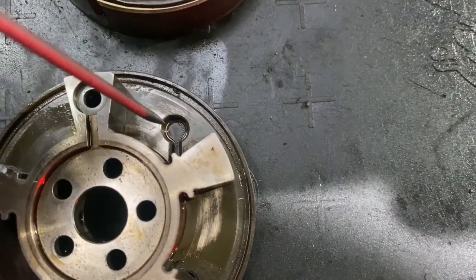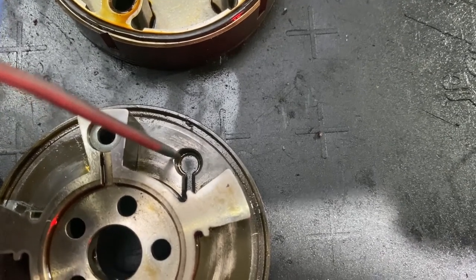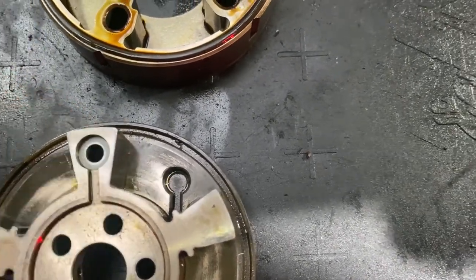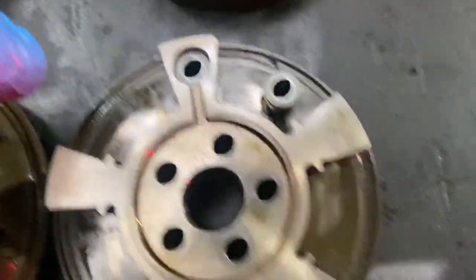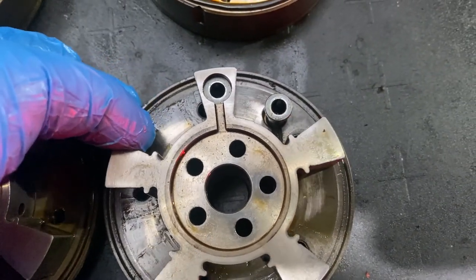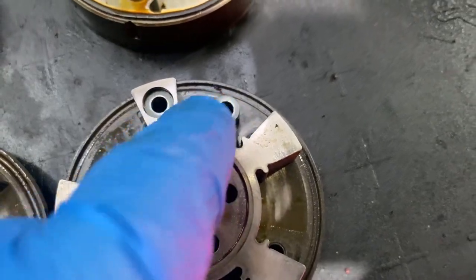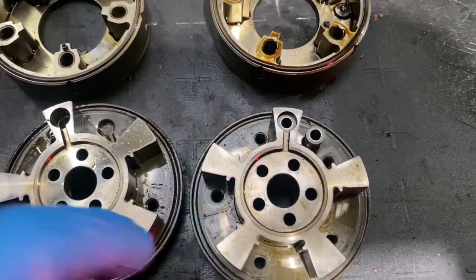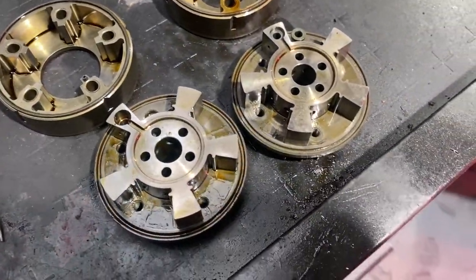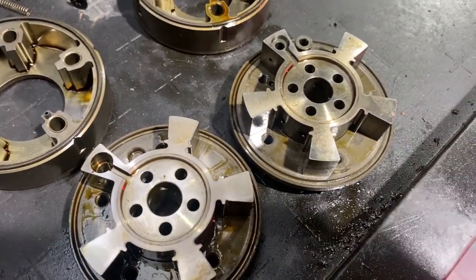So that means this side over here is not holding the pin properly and it's much easier to jump out, because the only thing holding it in place is this pin which is inside here, and if it comes out it allows the camshaft to adjust. As soon as it's worn out, as you can see over there, you need much lower oil pressure to push the pin out, and this camshaft will open sooner than the other one. Then you're gonna have a timing correlation fault. So yeah, I have to contact the owner now, tell him the bad news, and we'll see what we're gonna do.